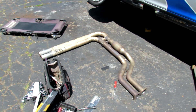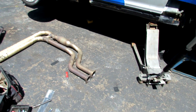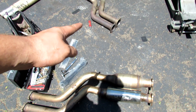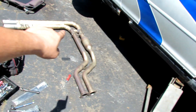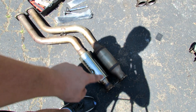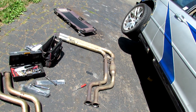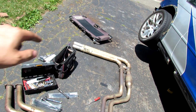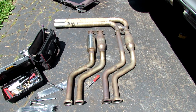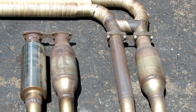So that's the whole setup. That's basically where it connects to the headers and that's the whole exhaust - that's literally it. This is the pipe that replaces that. As you can see, that only has one resonator, and now on that pipe where it doesn't have a resonator, it now has a resonator right there. So that's all we're swapping - just that first section. The back section is still not going to have a muffler or anything, it's still just going to be a 90 degree to the left. You can literally see they're exactly the same thing - it's just the resonator that's the difference.